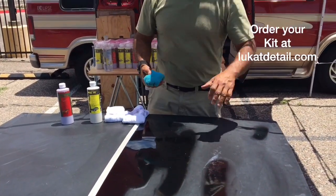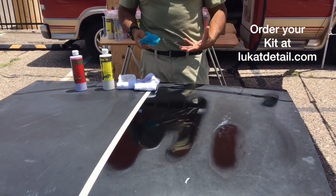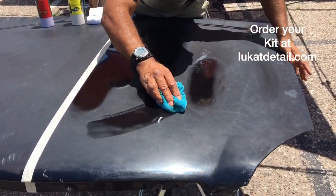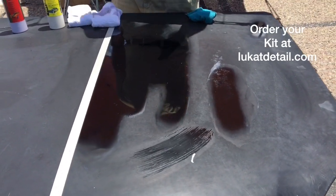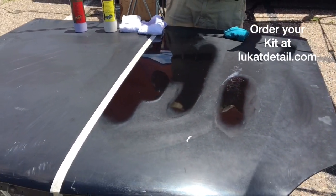Here's a wet towel. If the paint job on your car is getting hazy and dull, and you notice that it looks good when it's wet for about 2 seconds and it dries up, do not wax the paint job. You need to clean it, not wax it.